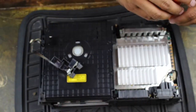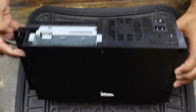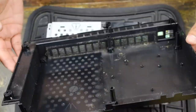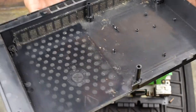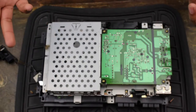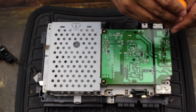There are a couple of screws here to remove. Once you get those screws out, flip it over very, very carefully because everything will just fall out. Lift up on the bottom half and it should come right out. As you can see, it's a little dusty and dirty. What I'm going to do is take an old toothbrush, run it through some water, and scrub the bottom and top of the case. It's pretty gross — I've already spotted some little roach bodies in there. Be prepared: if you get one of these old consoles at a good price, you're more than likely going to have to clean it up. Next I'm going to remove these four screws for the actual components so we can take it apart and see what else needs to be cleaned.